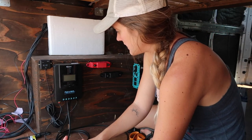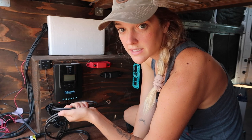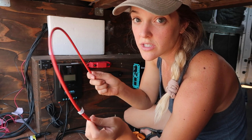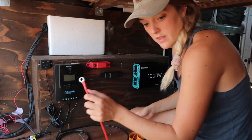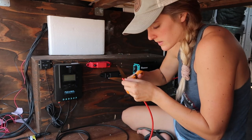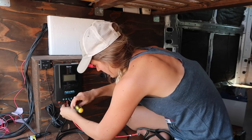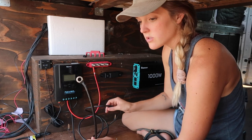What I'm going to do right now is connect my charge controller to my bus bars. This left one is a 10 gauge wire and it is positive. I don't need this 10 gauge red wire anymore — this had been connecting the charge controller to the battery. So I'm going to change this out so that they can be more color coded. I need to cut and strip this wire. The terminal's already on there, so this is all ready. I'm going to slip this in to the positive side — positive, positive bus bar.